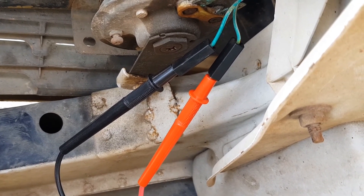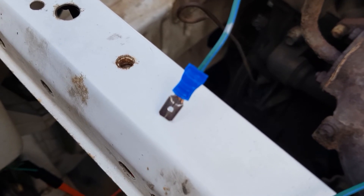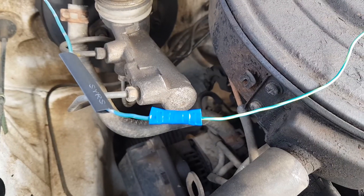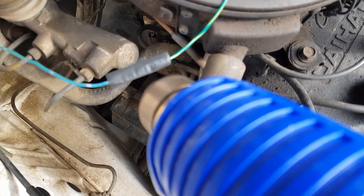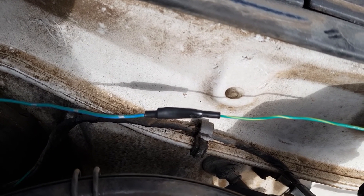So now we just have to make wires long enough to reach the motor. Here's the little connection I made for the end of this wire — I'll be plugging this into where the original horn wire is, so this can literally just plug in there. This means I don't have to cut into the factory harness and I keep my wiring neat. Unfortunately this wire doesn't actually reach, so I'll have to splice together another one to reach the little motor. I'll crimp those two wires together, then put heat shrink over it and melt it with a heat gun.